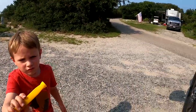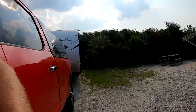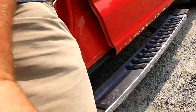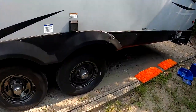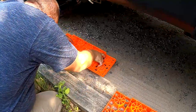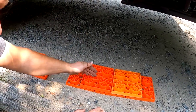We're going to pull forward just far enough to clear those levelers — that'll be about the length of the duals on your truck. I'm using my little mark that I made in the ground as my gauge. We've made our marks and we build out our system, then we slide this system right down into our tire tracks and line it up with the marks we made. This is nice sand — it shows the tire tracks really well. I built a little ramp profile into these; that's how they're strongest, stacked like Lego bricks, and that's also going to help the tires roll up over easier.